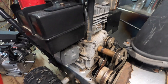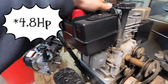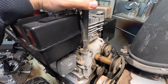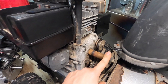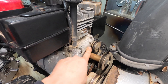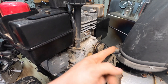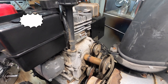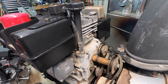This is a five horsepower engine that calculates out to about 4.9 horsepower. I've read that with the double shaft, you're not getting a full five horsepower rating on the main shaft because it's using some energy to spin the other shaft internally, so you're actually losing some output. I'm hoping that's not too significant since I bought a 4.9 horse and went down slightly in size instead of up like the Harbor Freight engine, but it's worth a shot.